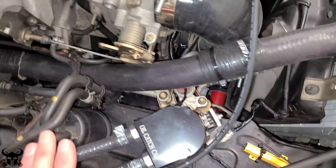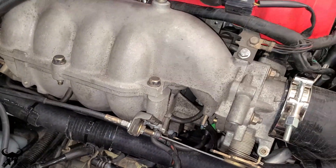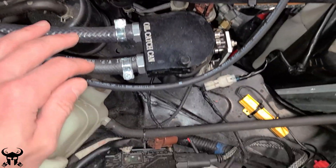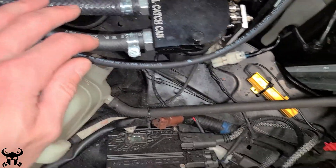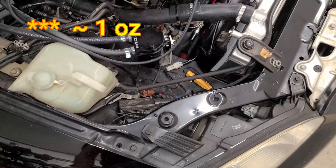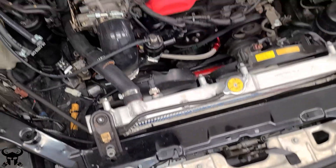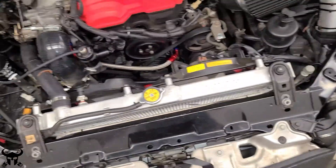I'm monitoring this one - if it sends a ton of stuff back to my intake manifold and starts gunking things up, I'll pull it and just run a breather. But right now I'm okay with this. This one has caught a little bit - a couple of ounces of oil in the last 400 miles. I think I've run this turbo for around 400 miles now.